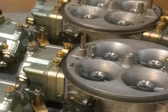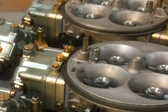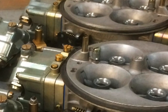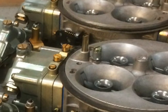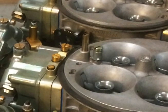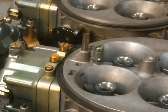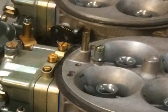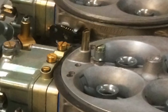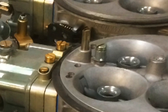Yes, I realize there is what appears to be a quote-unquote Venturi. The Dominator castings have a large radius on entry. You can also see a booster Venturi hanging in the middle, which is often confused with a Venturi. The reference to Venturi-less has to do with the absence of reliance on a point of restriction between the top of the carburetor and the butterfly beneath to create adequate pressure drop to meter fuel accurately.